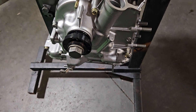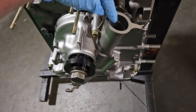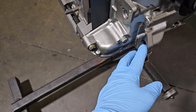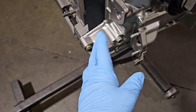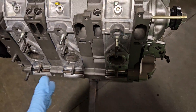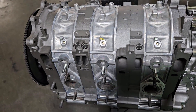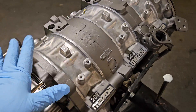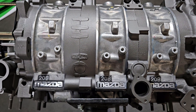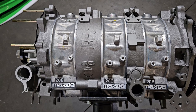As you can see, the front cover has the crank angle sensor that drops into the front cover, versus the reluctor-style crank angle sensor. It's also got a turbo oil return in the same place — basically the same front cover as your Series 5 Turbo. So on the front cover you see stuff reminiscent of the Turbo 2, but when it comes to the block components like your side and end plates and the port shape, it's a lot more like the FD3S. These unique motors share characteristics from both the prior Mazda RX-7 and the RX-7 introduced in 1993 — some overlap of when the Cosmo engines were produced and the 1993 to 1999 Mazda RX-7.